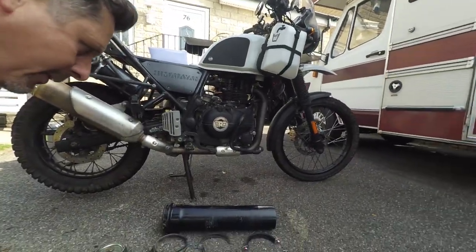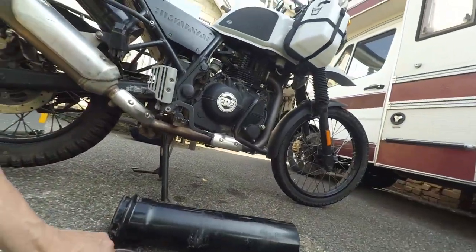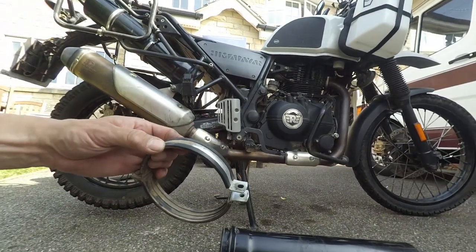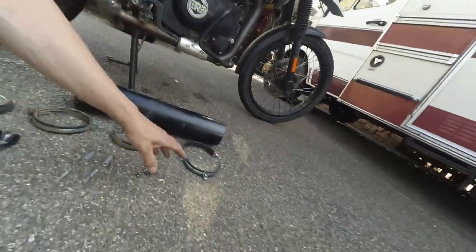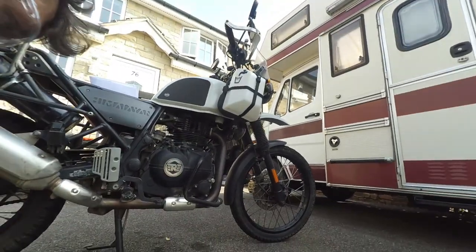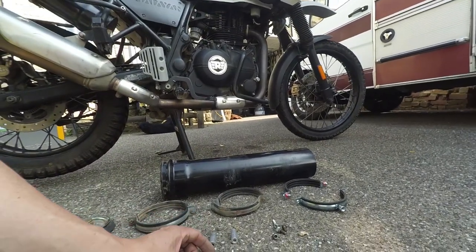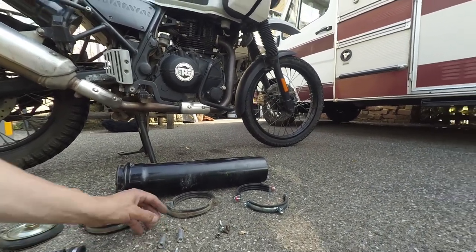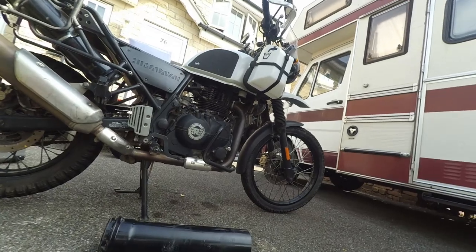So these are the things you need: your downpipe, end cap, inspection cap, two of the smaller pipe clips — something like 108 to 112 — the bigger one at 113 to 120, so that's 4 P-clips total. Some M6 by 45 bolts, 30mm spacers I made, some M6 nuts, and about four more bolts. I'm just using what I've got in the garage but you may need to buy them.